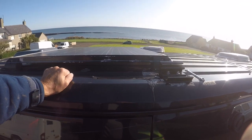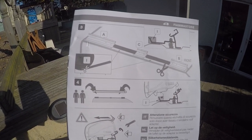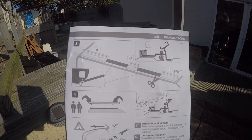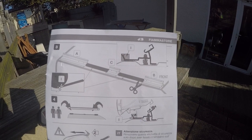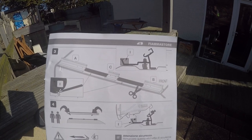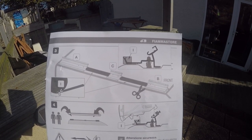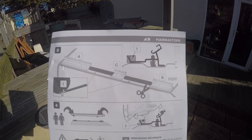The next stage is to fit the weather strip to the roof of the van. On diagram three, the three brackets are labelled A, C and B and the shaded area in between is the weather strip. Looking at that picture you'd think the weather strip would be towards the rear of the footprint of the brackets, however if you look at the insert — letter I, looking at it from end on — you'll see that in fact it should be positioned towards the front. And of course that's where I've elected to do it, as it makes more sense and that is the natural place that a weather strip of those dimensions would naturally want to sit.